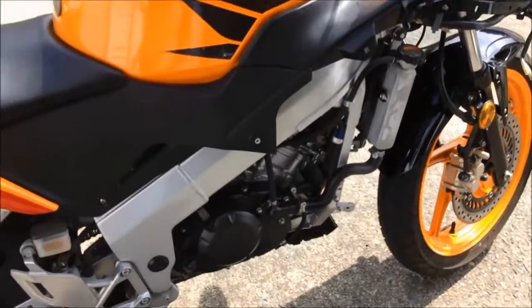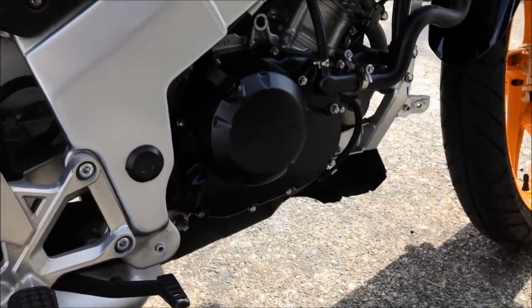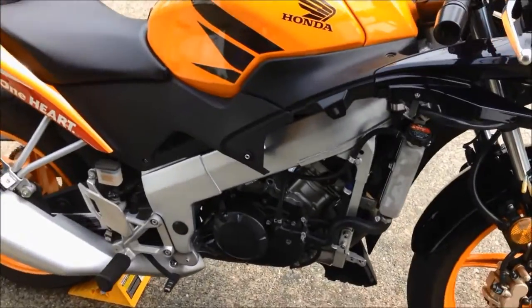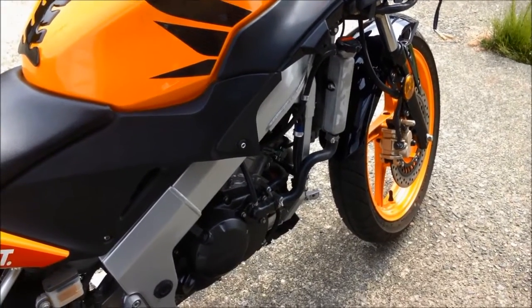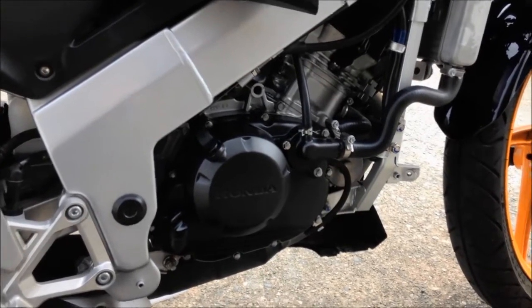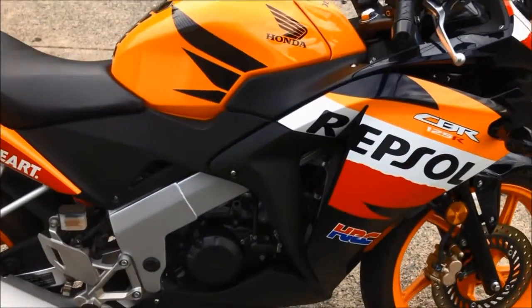Nice and smooth. New engine oil with a new spark plug. Just let the engine run a couple of minutes, and check the engine oil level again, and make sure everything is right on the level and also without any leaking. And then we can put the fairing back on. So everything's fine. It's in very good condition right now, a new engine oil and a new spark plug. And now we just put the fairing back on, in the reverse order of what we did before. We put back the side bottom work first, and then the side. Okay. The job is done, so now it's ready to go for a test drive.